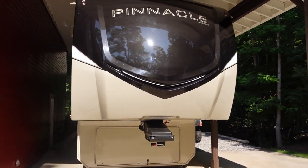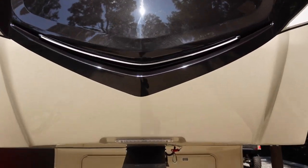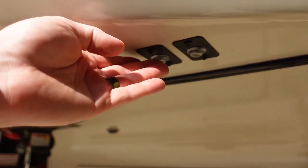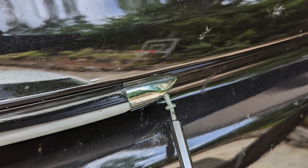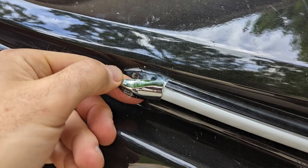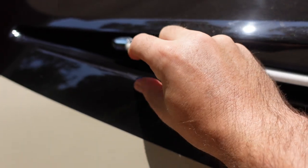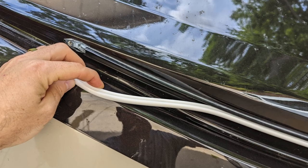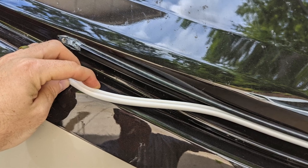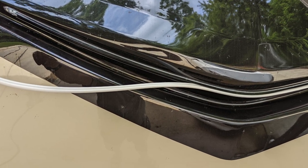Let's go through the process of replacing the LED step-by-step. First, make sure the switch is powered in the off position — we don't want power going to the LED while making the repair. Then take off the screws holding the chrome-colored caps on both sides; it's a square drive head. Place them off to the side so you don't lose them. Then, once the caps are off both sides, gently pull on the vinyl tube — the white part — out of the black track. On mine it was just a snap fit with no glue or screws.